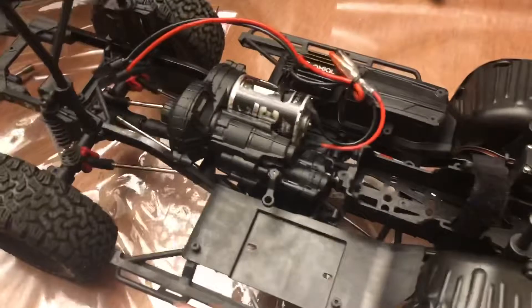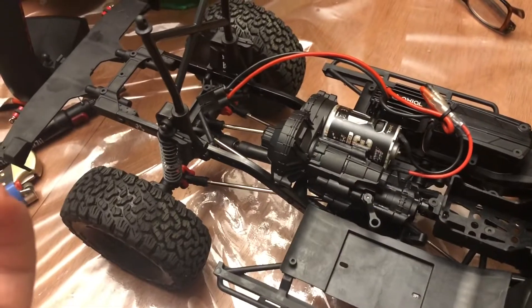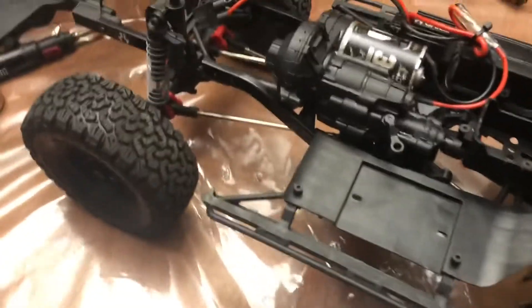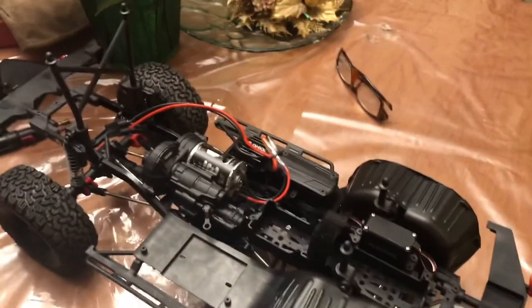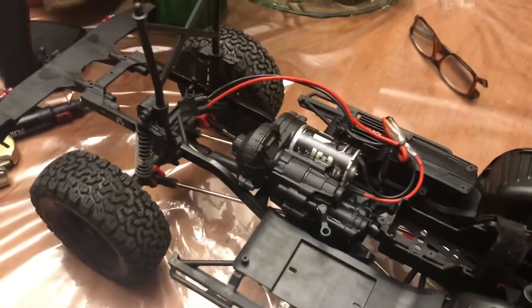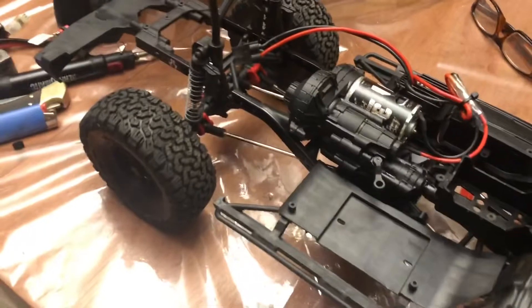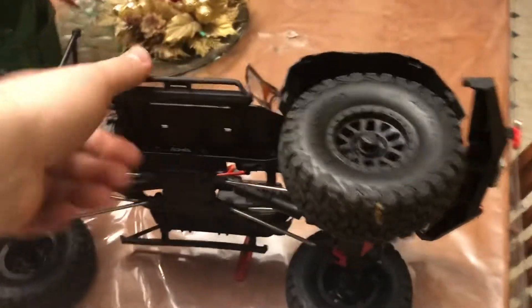There were a few other things — for example, the input shaft, which as you guys saw, I had to kind of machine down with some sandpaper. But probably more than likely your truck won't have that issue if you buy one of these transmission kits. And if it does happen to you, you can either just send it back if you're not comfortable, or do what I did and just sand it down enough to where the bearings fit on. Not really a big deal, just something to keep in mind.